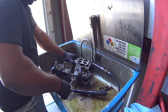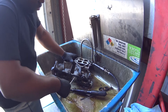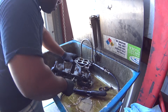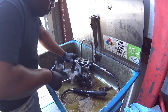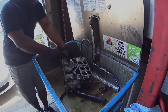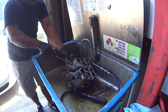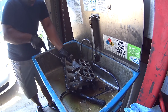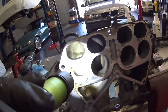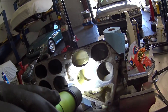I don't expect everyone to have access to a solvent tank, but this can be beneficial at removing some of the more stubborn bits of carbon. If you don't have access to a solvent tank, you can use some running water with oven cleaner to help remove stubborn gunk. It would also go quite a ways at flushing out the runners and removing a lot of the shed bristles from the brushes, so be sure all of those have been removed. You can see this agitating brush process cleans very well when used with carb cleaner — the runners came out nice and bright and I was very pleased with the results.